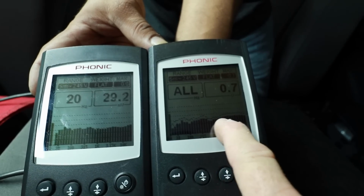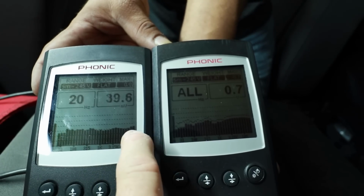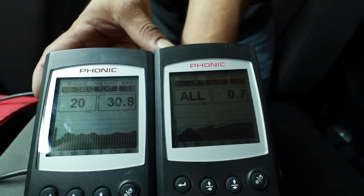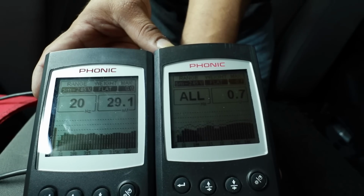The rear has this strange peak here too. It has this little bump right here, and then it's adding a little high frequency there for the tweeter. This area here and this area here look very similar, which is the mid-range. And that's why we said, if you like the way it sounds and you just want it louder, you don't necessarily need to go EQ, DSP, go the whole nine yards. If you are changing speakers and you find that the bass, mid, and treble adjustment on the radio isn't enough to get you where you want, then you definitely need some form of an EQ DSP.